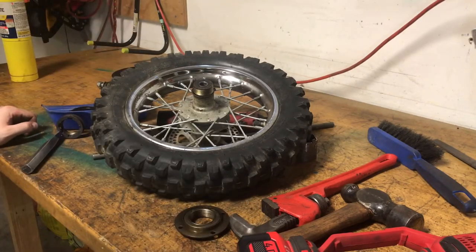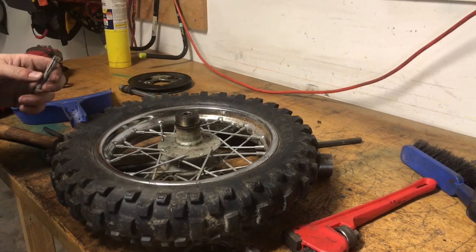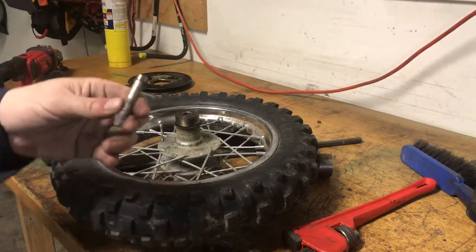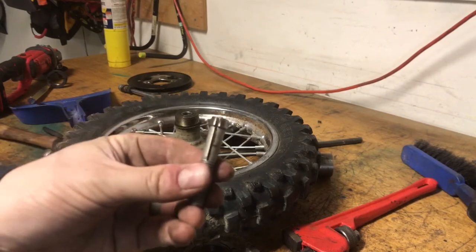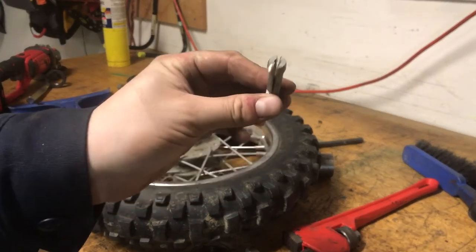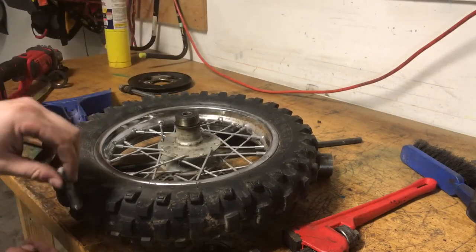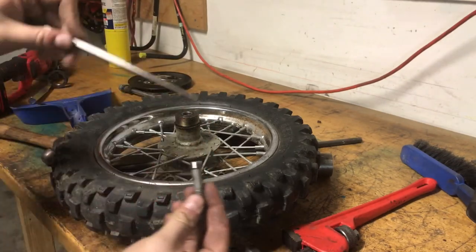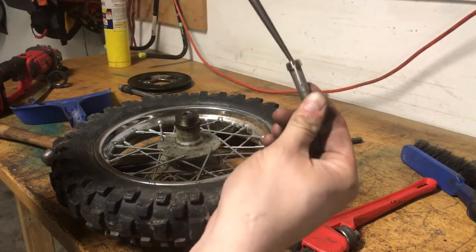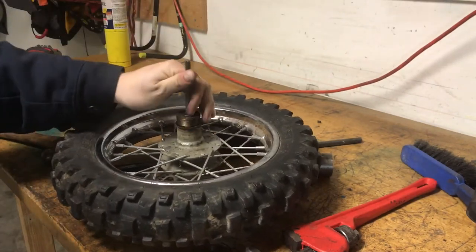On down to bearings. For knocking these bearings out I made a little tool here — I actually did this before on a previous video for removing minibike bearings, just happened to be a different size. Just take a bolt, grind it down kind of a cone shape, drill a little dimple down it, then split it down the middle. What you do is insert this in head first — once it pops through, it closes up a little bit as it goes through, and it expands out. To keep it expanding, flip it over and take a punch that'll fit in that little divot. As you hammer it from the other side, it'll expand out and allow it to pop out, because if you try to grab the other race sometimes it just keeps sliding out.